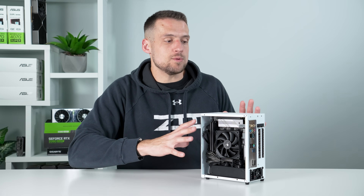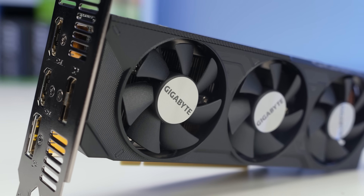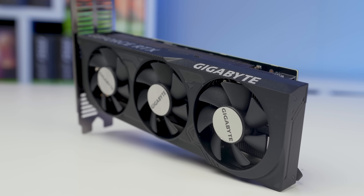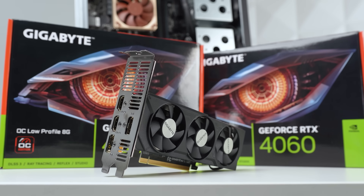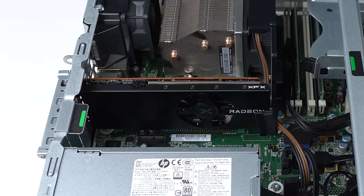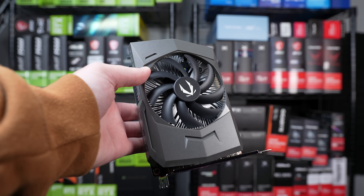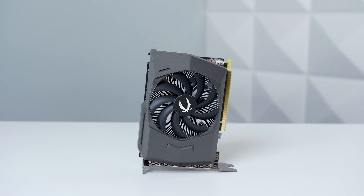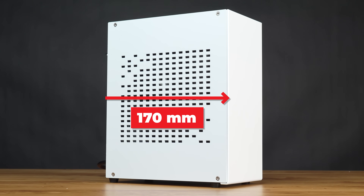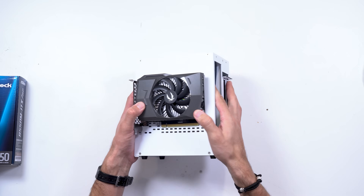For tiny GPUs, there are three different types. There's low profile, like the Gigabyte RTX 4060 and 5060 — those are half height but have three fans, so the length is too long for a case like this. There are also single slot GPUs you could put in a cramped office OEM PC, but options there are extremely limited. That's why I love that this Joyjom actually allows for a two-slot GPU, but just barely. The last type is single fan, sometimes called ITX GPUs, which limits length — and that's required since this case can only hold GPUs up to 170 millimeters long.